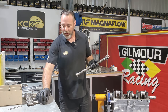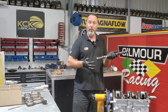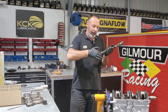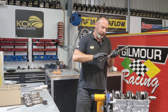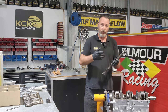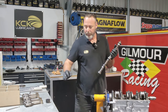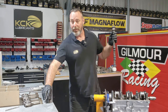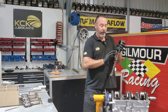It's a Ford part number cam - the cam we have to use. The crankshaft is also a Ford part number crankshaft. We can use a Scat crank but it has to be a little bit heavier, so there's no real advantage in replacing it, which keeps costs down. Heaps of assembly lube on the cam lobes and on the bearings. It's not a bad trick to have a long handle or a threaded rod with a bit of bar on the front to help guide the camshaft in. You have to be really careful - the bearings are quite soft and you can't go bouncing the camshaft around over them or you'll rip big holes in them.